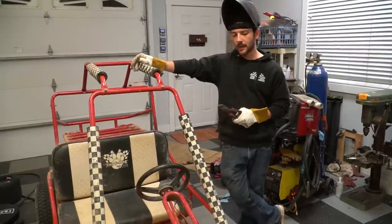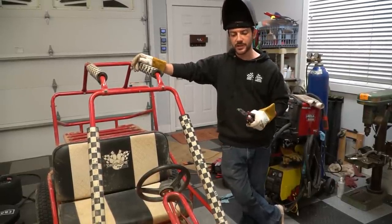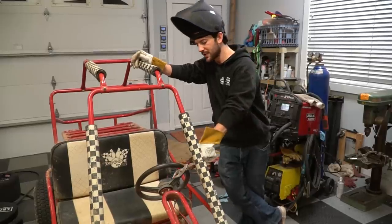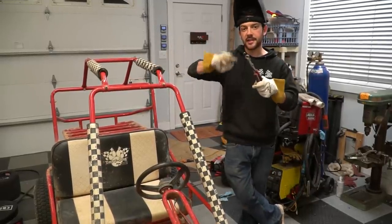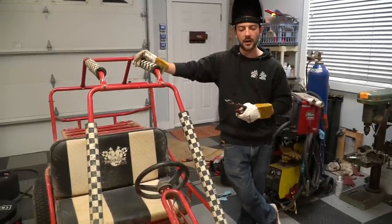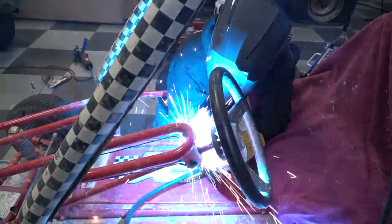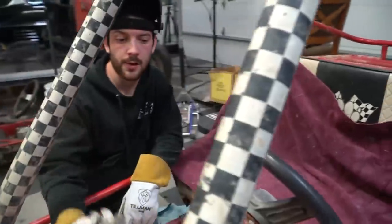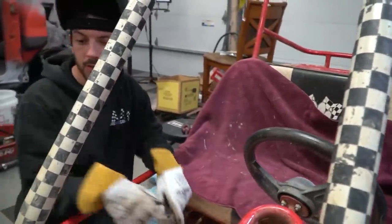So we still have a little bit of carburetor tuning to do, but we're going to move on to installing the lights and the switch for the lights. I'm going to start by welding these two washers next to our engine kill switch. That's where we're going to mount our toggle, and then we can work on wiring for the LEDs up front. So I can screw in the switch, and we can wire up the lights.